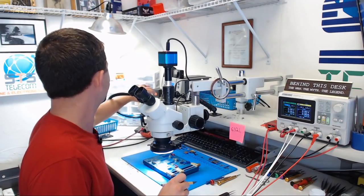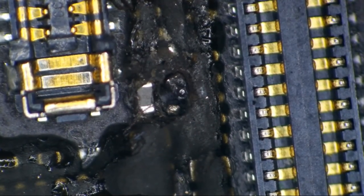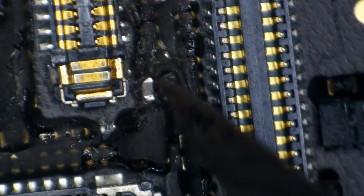There we are. Now, first what I'd like to do is just go ahead and fix this backlight filter. That's pretty well straightforward. All right, so let's get some hot air going. I'm gonna set this at 235C, airflow of 75. So with this low temperature, this is gonna let me clean back our rubbery coating here.